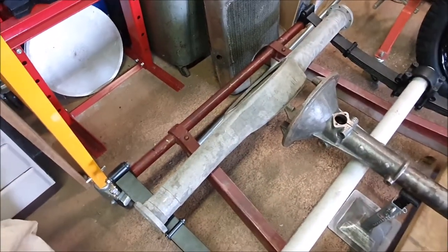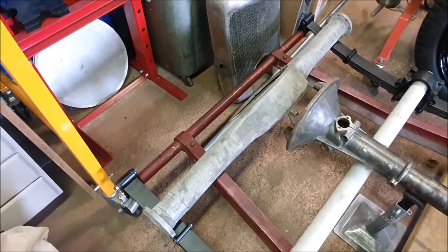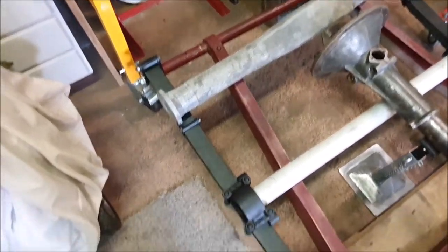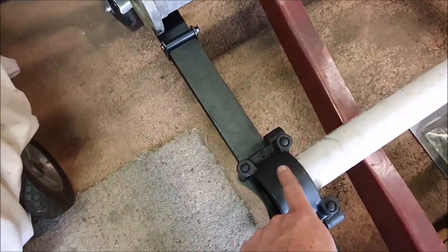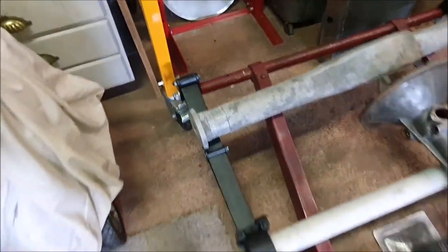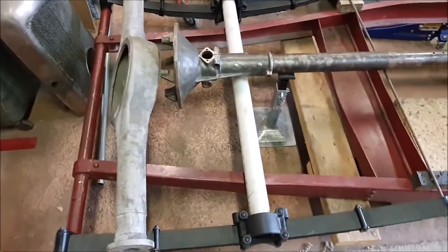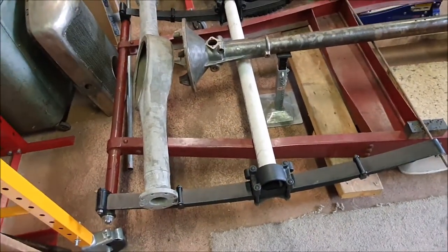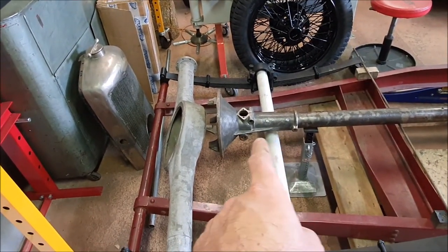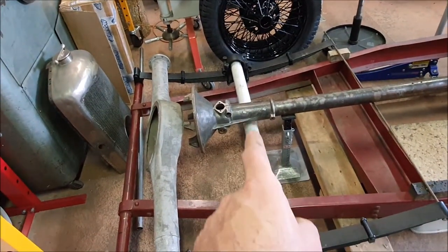It's currently 26 millimeters too wide, so I need to take a little more than half an inch off either end. Then the axle will line up, because what you need to do is get these trunnion blocks to line up with the grooves in the axle — the axle rotates in there. It also finally gives me an idea of exactly how much shorter I need to make the torque tube, because now I know where the axle is going to sit on the body.